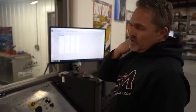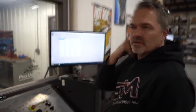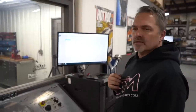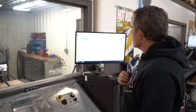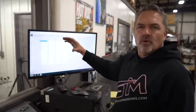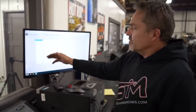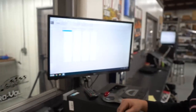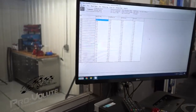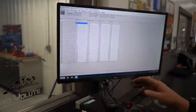I might be able to do a high speed air bleed change, but I gotta look at it and see if they're replaceable or not. And I don't mind having a bunch of fuel down here in this low area. It just keeps things safe anyways. And typically up here, it's not a big deal. It's still 15 pounds of boost, so we're pretty good there. Yep, everything looks pretty darn good. Pretty happy with all that.